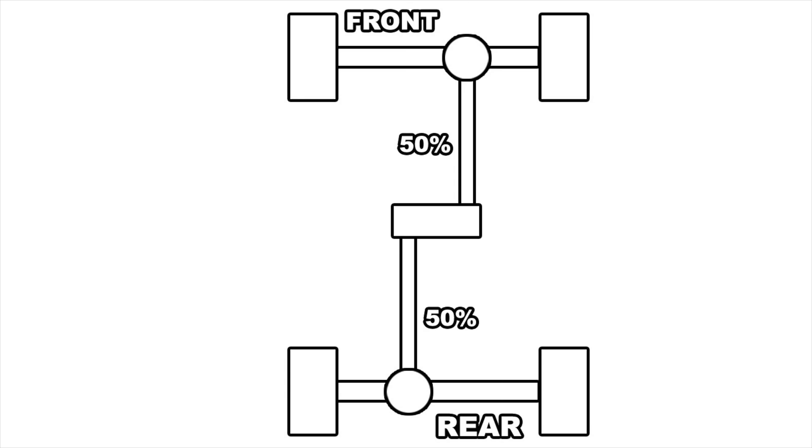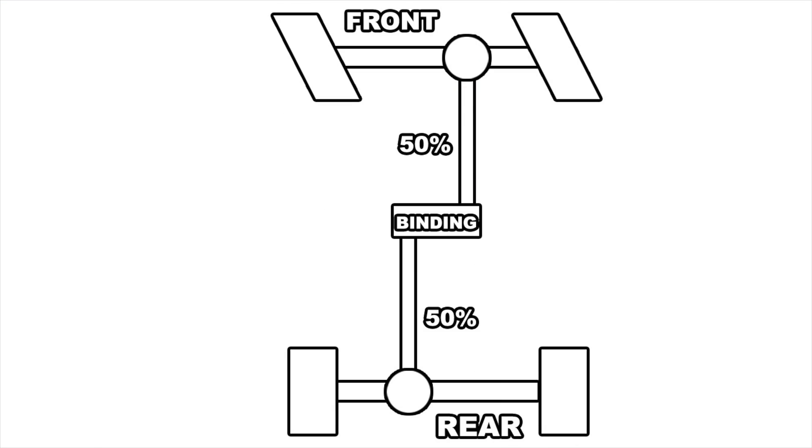The typical four-wheel drive system splits power between the front and rear axle 50/50 — front axle gets 50% of the power, rear axle gets 50%. The problem is when you turn, the front and rear axles are rotating at different speeds. With the axles locked together at an even power split but moving at different speeds, you end up with binding in the system because the front axle needs to move at a different speed than the rear axle but cannot because they are locked together. This binding won't happen in a low-grip situation like dirt, but on the road it will cause massive damage in your driveline over time.